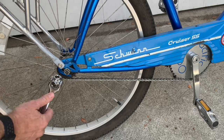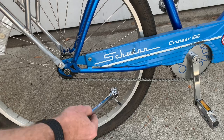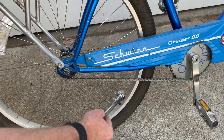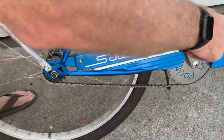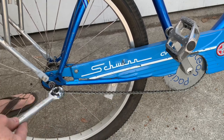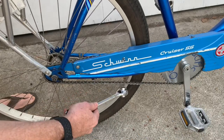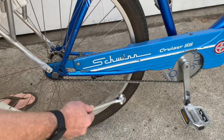Now that you believe the wheel and chain are in the right position, make sure you've torqued them down enough with your wrench, then do a chain check — there should be a little bit of play in the chain. Turn the wheel a little bit and check for play again. A chain is going to wear unevenly on the sprocket, so in some places it'll be loose and in others it'll be tight. You have to walk the line between loose and tight and make sure there's always a little bit of slack in the chain.